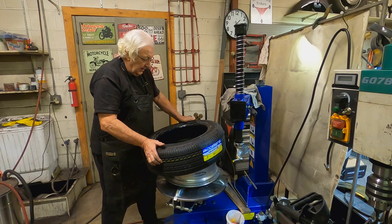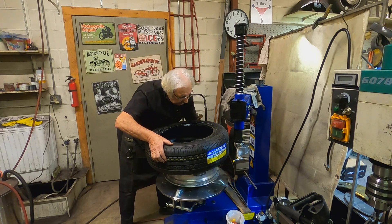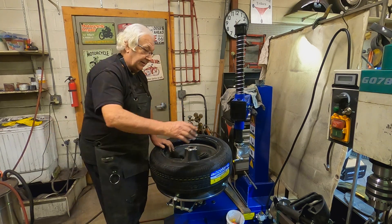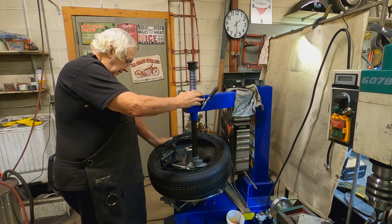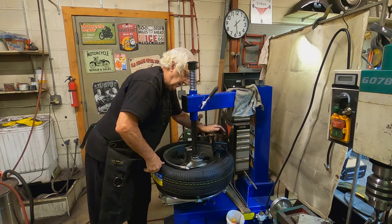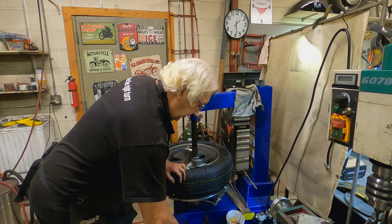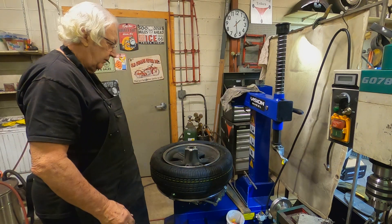This does have a TPMS sensor on here — well, not really, it's just got a standard steel valve. I'm going to leave the valve up there. And as you can see, going on is a lot better than going off. That seemed to work very nicely. Going on is pretty easy — doing those by hand is basically as easy as that. It's the removal that's tough.